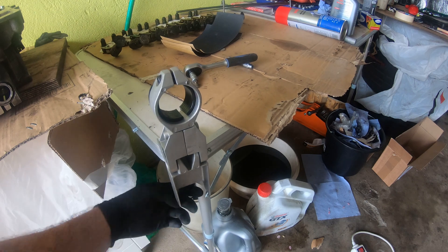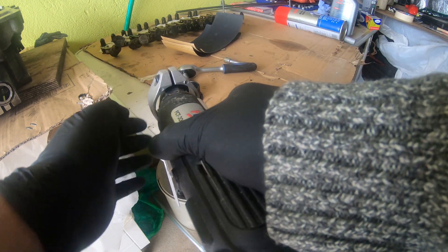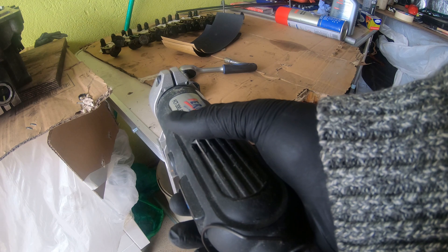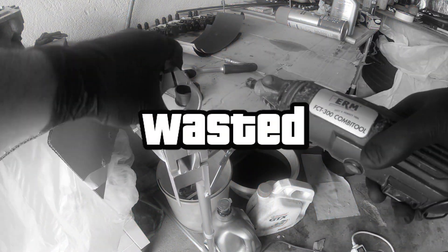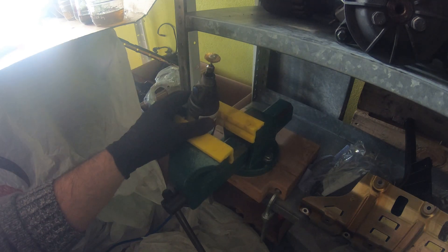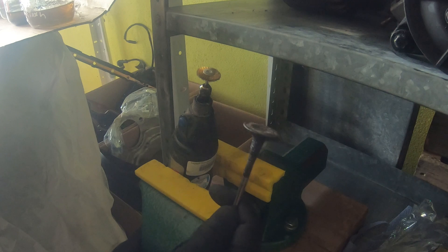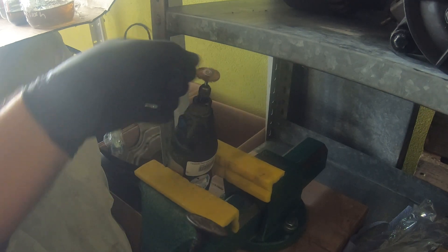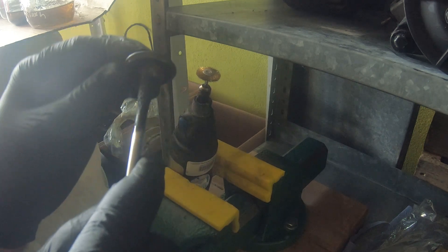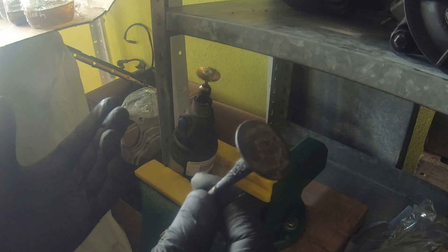So let's just get started. Well, this is a lot smaller than I needed it to be. So I couldn't get that thing to work. What I've done is I've just put the Dremel in a vise, and I'll just have to work from down here. What we want to do is turn the Dremel on, and I have this little fine brass brush. Brass is nice and soft on metal, so it shouldn't grind it away or anything. We're just going to go back and forth, clean up the valve, clean up the bottom, get all this carbon off, and go one by one.